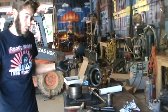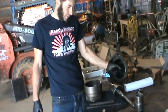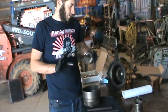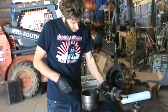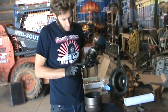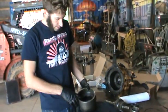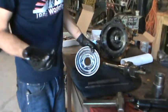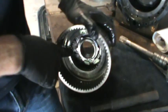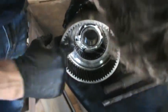This didn't have forward. Forward is contained inside here. There's your sun and planetary gears inside here. This is your input shaft — slides inside there and engages your sun gear and your planet gears. And this is your input shaft coming off of your torque converter. The charge pump is this thing right here. But in here is the real issue where your forward gears are contained. It's all these clutches inside here. And if you can look closely, they're burned and they look like shit.